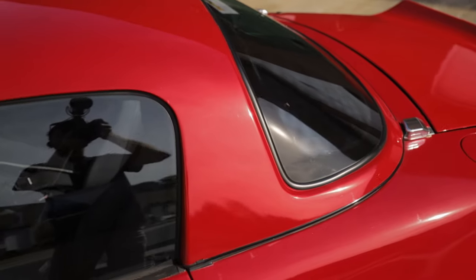Someone recommends a hard top, and I definitely agree. I love the hard top — I actually removed the soft top from my Miata. One thing that may be overlooked: the hard top isn't just for looks, it actually adds rigidity to the chassis. Anytime I take the top off, I can feel the car is a lot more jiggly and less solid. Hard tops are also a good investment — they consistently sell for around a thousand dollars and don't really go down in value. They look good, make the car ride better, and I definitely recommend them.